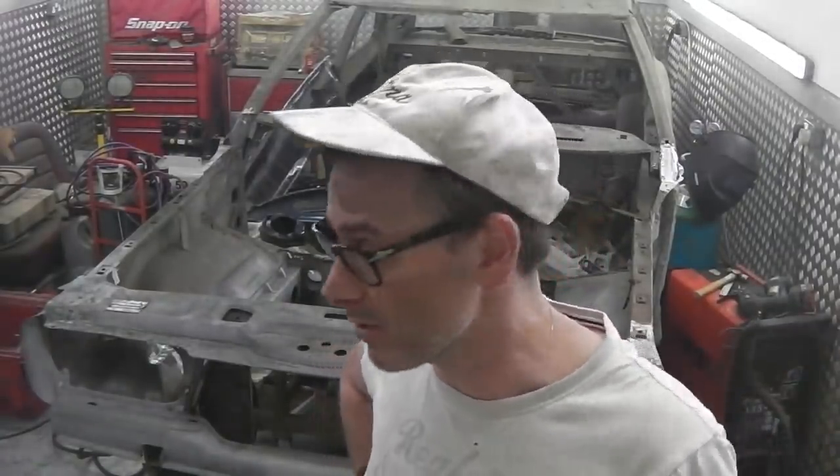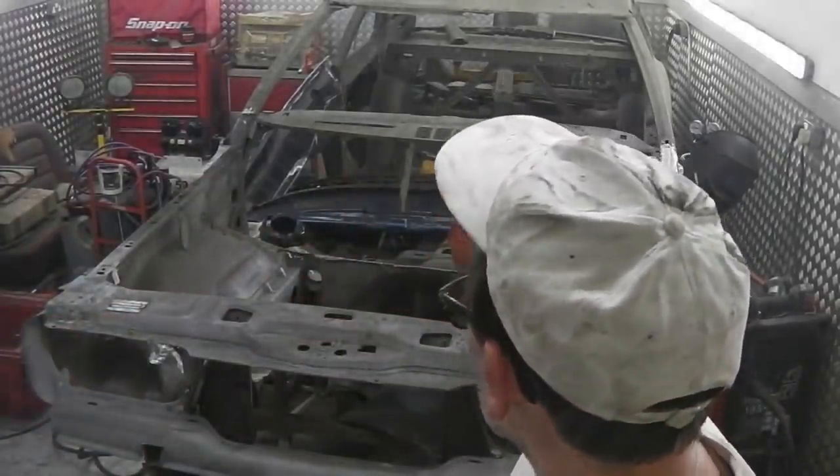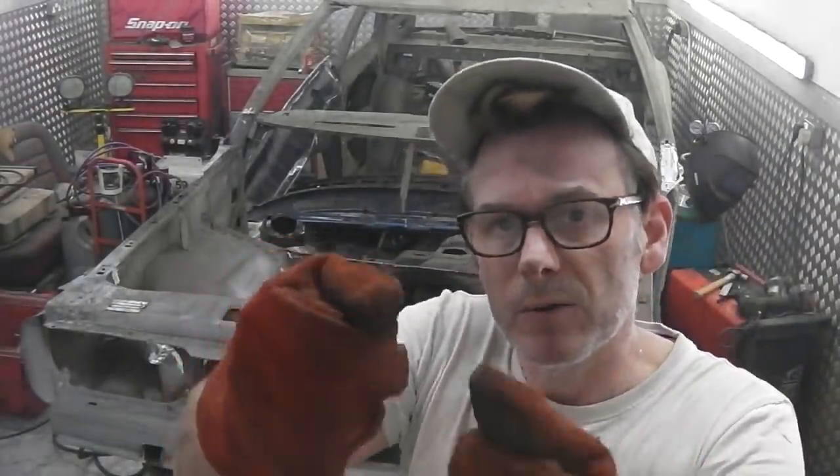And you've seen us prepping the bulkhead, putting all those new edges on it and lining it up. Now we're going to see how it fits in, and we want to be paying particular attention to the dashboard. You can see the dashboard going across there, that crescent shape. That's got to line up nicely with the lip now. Then we can spot weld it in.